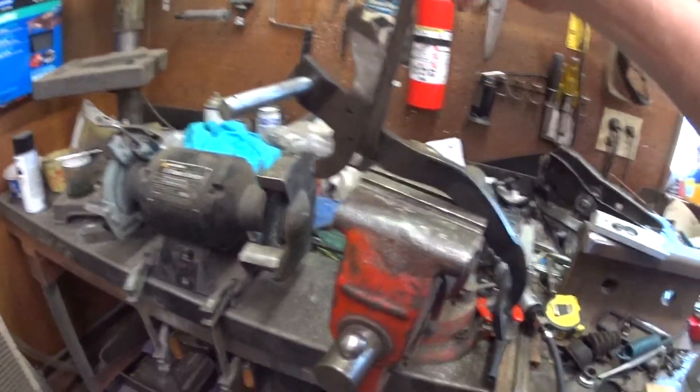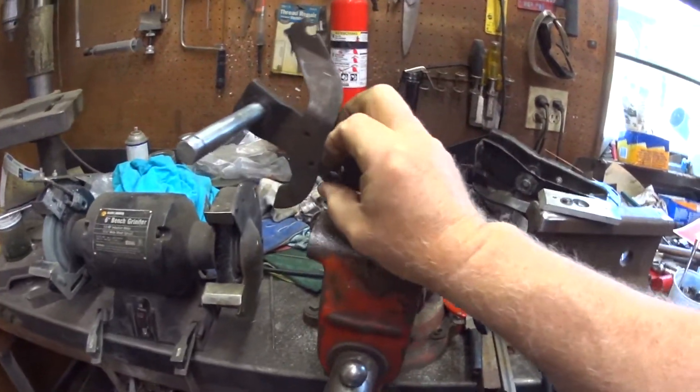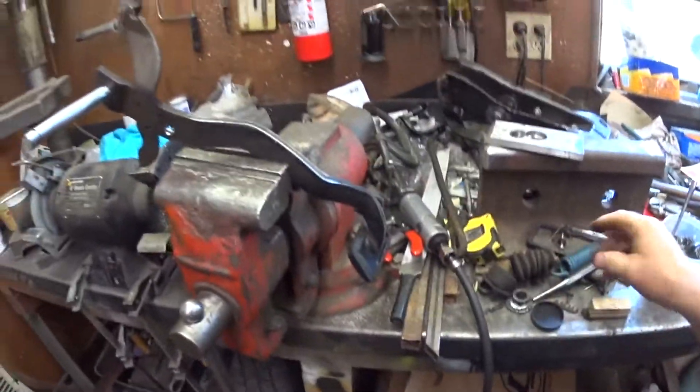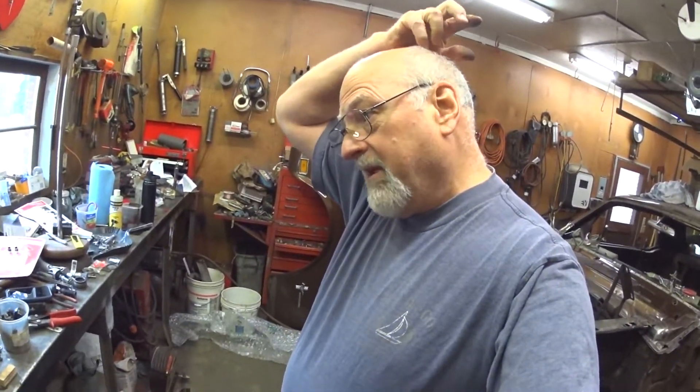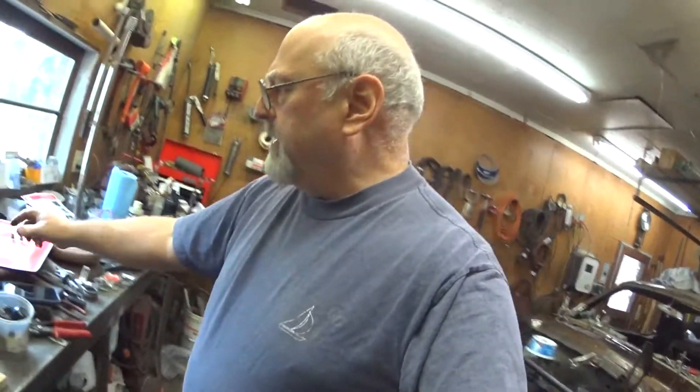I figured I got these parts, so I can have a minor success of getting something fixed and ready to go back in. I kind of thought I might put this cradle back in before I weld the cowl in, just because it's so easy to just drop it straight down in there and bolt it in. But then, do I really want the pedals in my way when I'm underneath there welding the toe board back in? I don't know — I haven't decided yet.